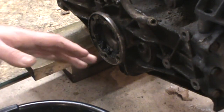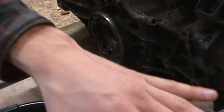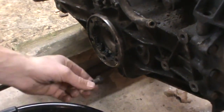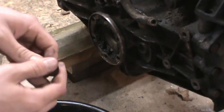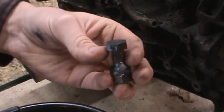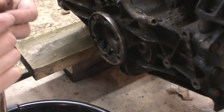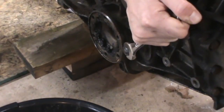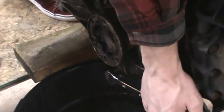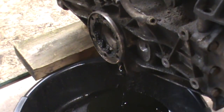The first thing you're going to want to do is drain the fluid. I left mine standing upright overnight so all the fluid could make its way down into the bell housing. Down here is the drain plug and the fill plug is right here — they're both 17 millimeter female plugs. If you don't have a driver, I found that just welding a bolt and nut together makes your own driver, which is what I made to undo the plugs. There's not much fluid in these at all.